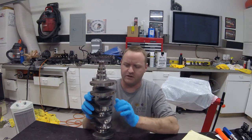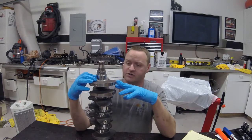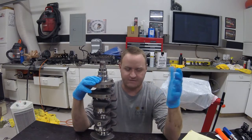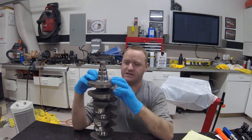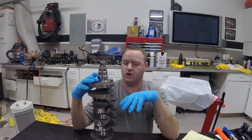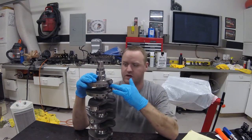I did have the crank polished because of that slight marring — it did not need grinding, everything was still in spec. I had it cleaned in the parts washer at the machine shop, and then the machinist did polish the crank. One thing he did say is, just like the block, you must deep clean this afterwards. The parts washing he does is just designed to clean the crank for machining, not for assembly. After machining, there may still be metal fragments from the machining process stuck in the oil ports or oil galleries of the crankshaft.